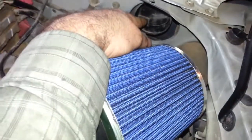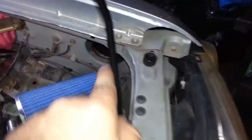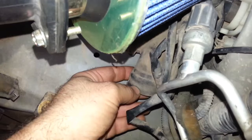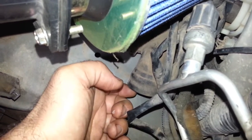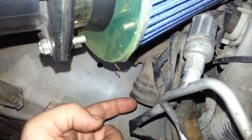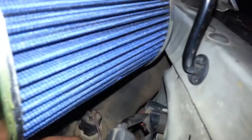My concern is that I always thought I had a cold air intake — look at that, that's where it pulled the air from, right? Not really. That tube comes around in here, and I suppose it picks up some cold air while it's there, comes around to this tube, and that's your real air intake. So everyone thinks they have a stock cold air intake when they look at this at a glance, but engineers find a way around that — and this isn't an exception. This is the real intake, and there's an intake air temperature sensor, and it goes up there and around just to give the appearance of a cold air intake.